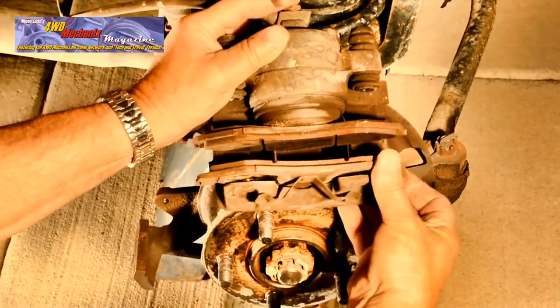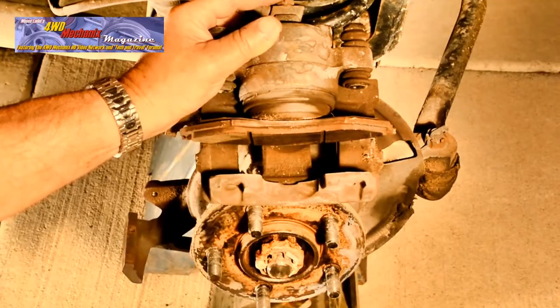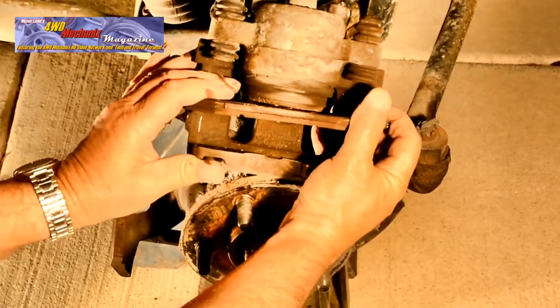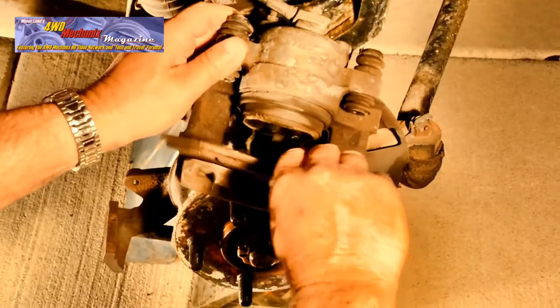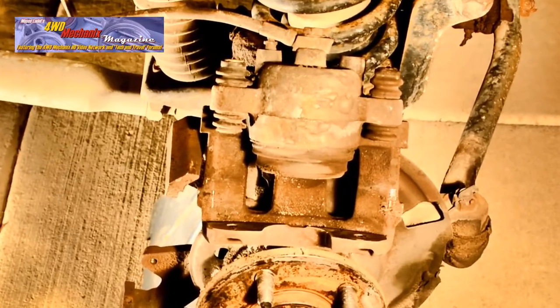Remove the brake pads as you did at the left side caliper. Start with the outer pad. Remember the two tabs. The inner pad should be grabbed evenly and pulled away from the disc caliper piston. Make sure that the seals and all other parts of the caliper are in good condition.